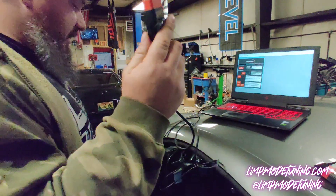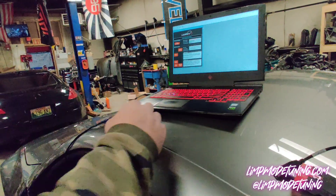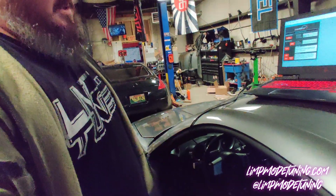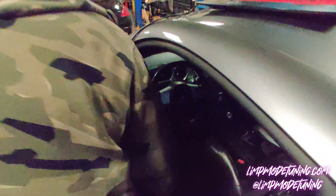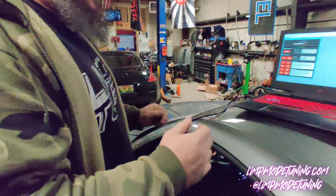We're going to take the cable and plug it into the vehicle's OBD2 port, which is located underneath the steering wheel to the driver's side, as well as on some of them towards the center a little bit. Once that's plugged in, we're going to take our key to the vehicle. On the older cars you have a key like this; on the newer cars you have a smart key. You're going to put it into the on position — past the accessory to the on position.